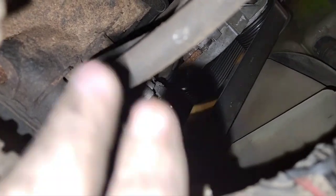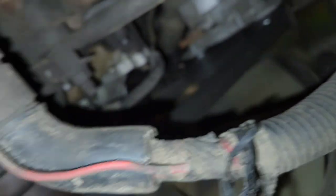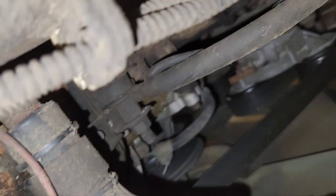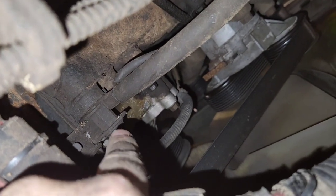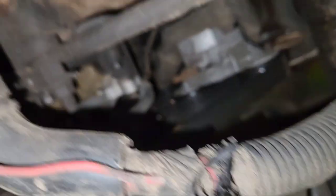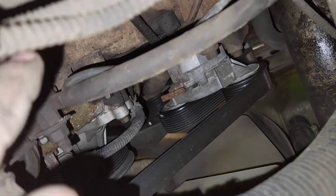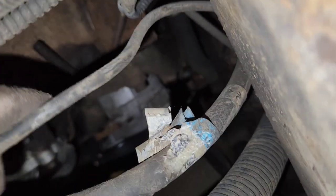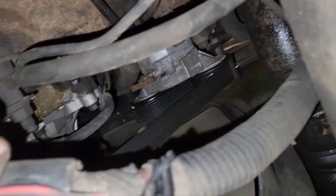Here's the culprit — I forgot about this little hanger. This is the battery negative to engine from the driver's side, and it is loose. That might be part of my hard starting issue in winter. This bracket up here is what actually holds it — it's also where the battery negative goes and where the trans cooler lines mount so they don't rub on the oil pan. I need to get a socket for that, looks like a 15mm — pull the nut off and all this should slide right out.